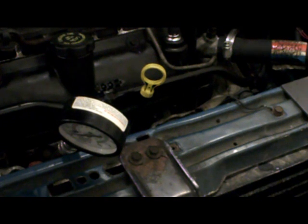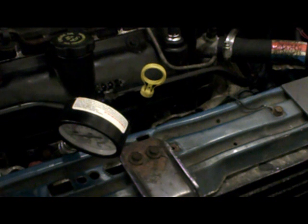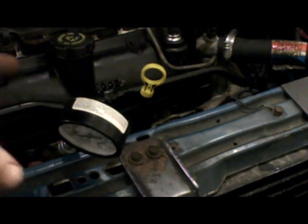Do that for the remaining cylinders. If you have any variances more than 10%, chances are you may need new pistons and rings. If you have really low compression — say 70 on one, 60 on another — chances are you're going to need a new head gasket. So far we're looking good on this side of the motor. And that's about it.